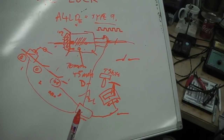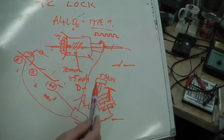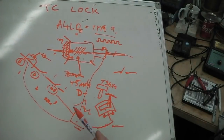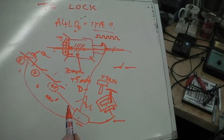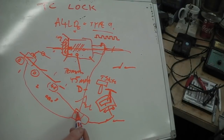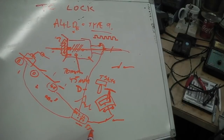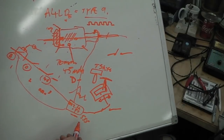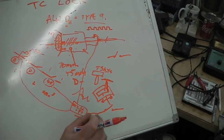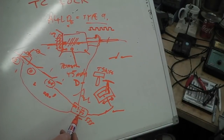So we could make it 20 seconds. It would only say, right, I'm happy with the output. Everything's nice and steady for 20 seconds. All these are switched. I'm over 45 mile an hour. There's no spikes or anything coming in. Everything seems steady. Now activate. So that's a second level on top of the chip, on top of the 2917. We're going to add a 555. That's our off-the-shelf lovely little timer. We're going to do it in what's called one-shot monostable operation, which means once it's on, it locks on till the power's off. That's an extra little level of safety.